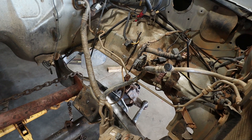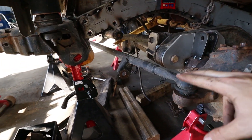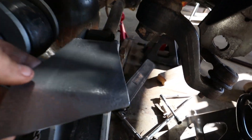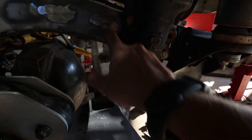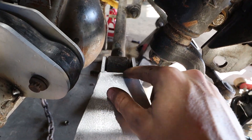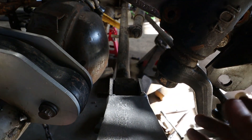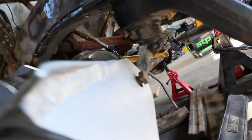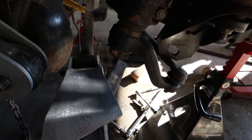You can see when I push it, we've got steering — how cool is that! The arms are actually upside down because we're trying to figure out how to fit everything in. The only bracket we're changing is this panhard bracket and we're trying to figure out how both arms look when it's in position on the chassis — we want them to be parallel. The trouble is this panhard bracket wants to contact the panhard rod, so I might have to put a radius in there. I was hoping flipping the radius arm upside down would give enough clearance but it hasn't, so I'll turn them around the right way.